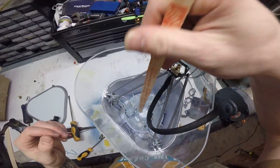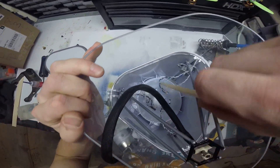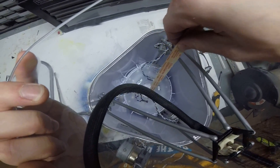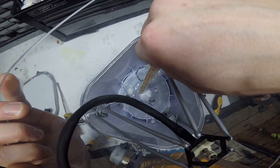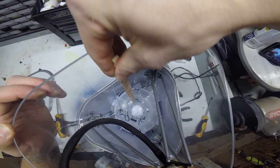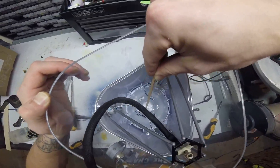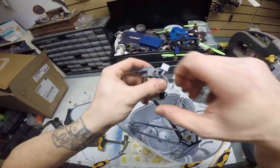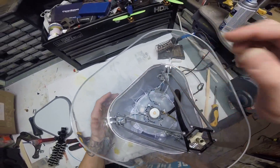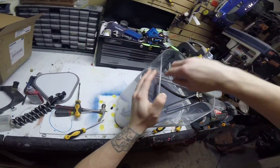Like I was saying earlier, everything's got a key. So on the chip there's this tab here and it'll sit on top of that — just like that. There's that tab that locks it. There's a tab here and a tab right here that you need to line up or you'll never get this thing on properly. Up and down in there — that was easy enough to line it up. Clicked her in there, there we go.